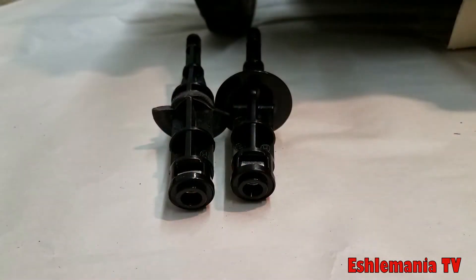Here we have our new joystick on the right side and the broken one on the left — that's a pretty good chunk missing out of that flange on the broken one. What would happen is when that broken joystick got pushed to the side, front, or however the body would move, it would tend to jam up. And even though that one didn't have a sensor on it, because it was connected to the body, it was actually pulling and holding the other one on the right side — the one with the sensor in it — into a position that would trip the alarm and say there was a rear collision problem.